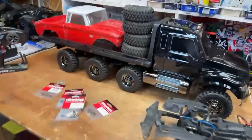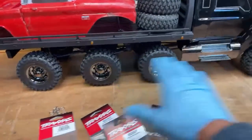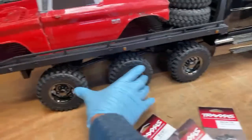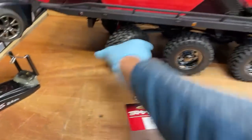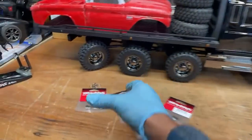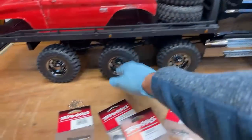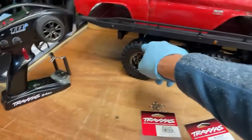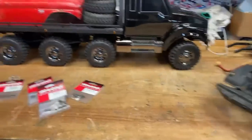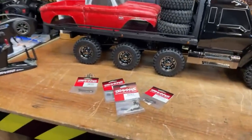So this here, look, let me quickly show you this. Flip you around. I was over in Jason Redfin's shop the other day, and he built this for me. So normally these are 6x6, so it's got two axles like there. But Jason added another axle to make it 8x8 and also gave it rear wheel steering. A few people have done similar conversions, but they've added an extra axle right on the back. But then you end up with a big gap here with no wheels, and then it gets hung up on stuff quite easily. So what Jason did is move that axle all the way forward, move this axle back more, put one in the middle, and give it four-wheel steering. So now this thing is crazy capable, and we're going to be taking that out soon. There's going to be a video on that.